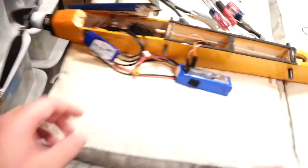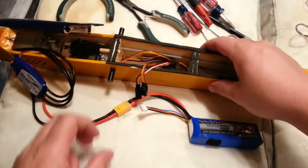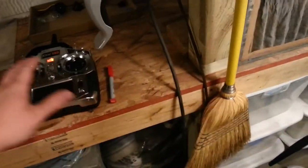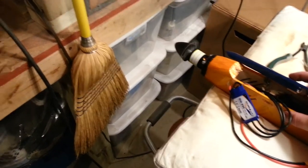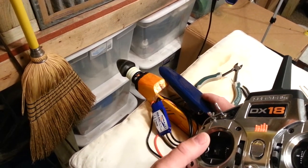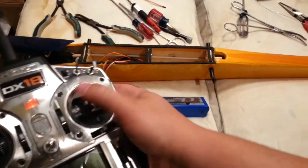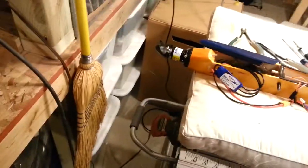We'll make sure throttle cut is on and go ahead and reestablish power to the airplane. Now, notice it didn't go beep-beep-beep-beep — that's going to be your braking is not on. If it doesn't do the second beep then you know braking is on. So there's throttle and braking — throttle going the right direction, and braking. Looks like everything's working there. Throttle cut is on and tested.